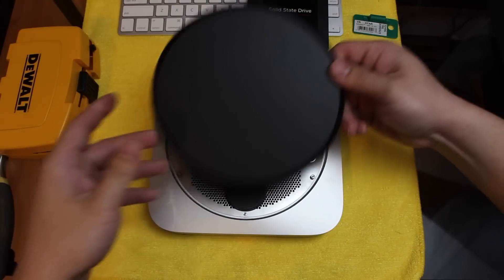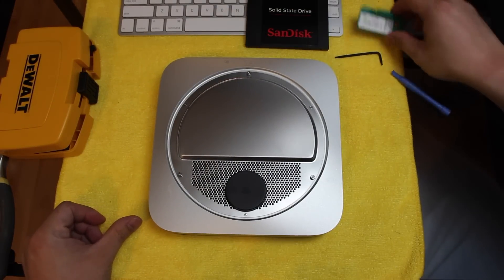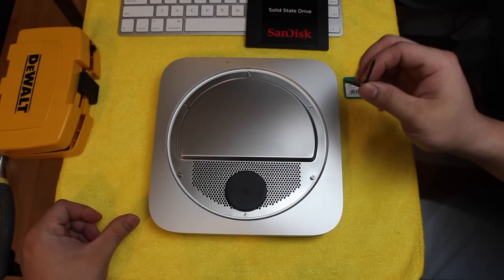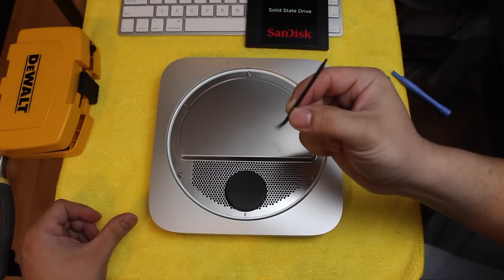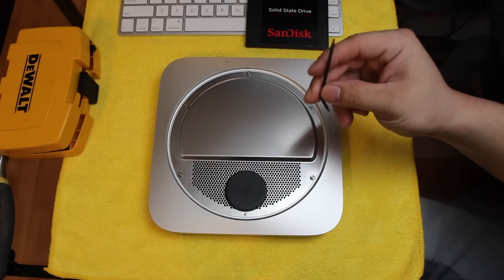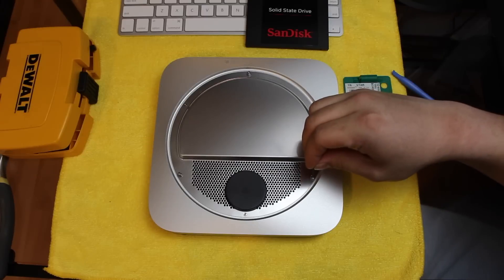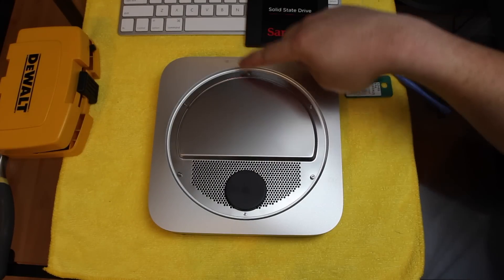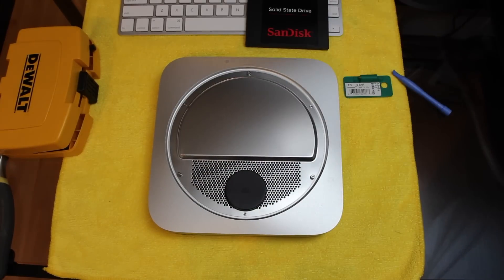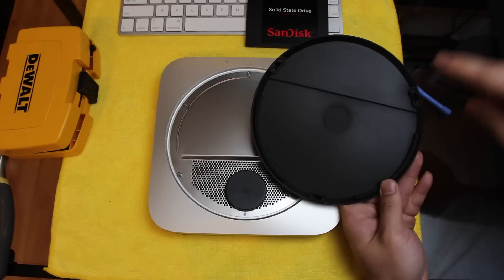You might accidentally scratch the aluminum casing. So popping that off, we'll set that aside — the Mac Mini cover. We are first greeted with these TR6, that's a tamper resistant Torx 6 screw. This is the tool I'll be using — I'll put a link in the description for that. I found this cheap on Amazon or eBay. One thing to note is these three screws are larger than the others, but the screw size is the same — they just pop up a little because they're what's holding the cover in place.